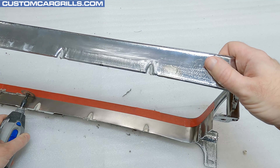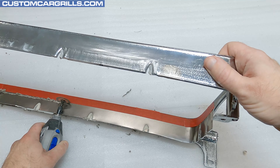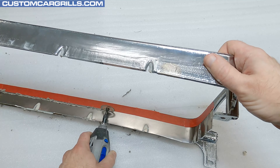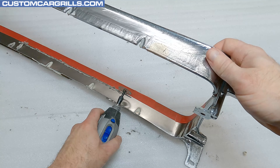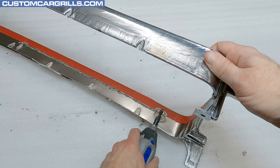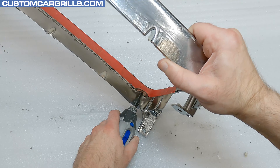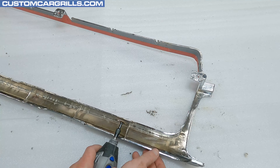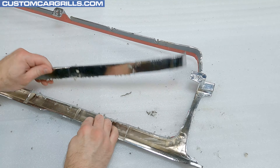Now on to the cutting part. I'm using my Dremel along with the cutting and shaping wheel attachment again, just cutting close to where the tape line ends. Patience and a steady hand are keys to success here when looking to make some clean straight cuts. If you're not familiar with these types of mods, it might be best to back away from the cut line a little bit — maybe a sixteenth of an inch or so — to have a little margin for error. Any waviness with the cuts can be sanded out later, but it's best to just make some straight cuts initially. On the back edge of the grill, there's some connecting material that extends to the front. This needs to be trimmed down so that the edge that was just cut can be released from the grill frame.